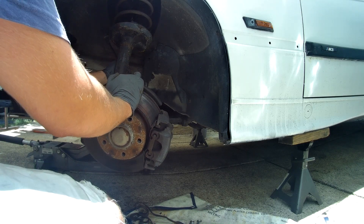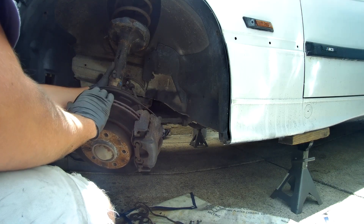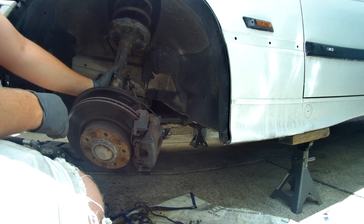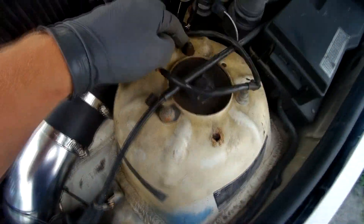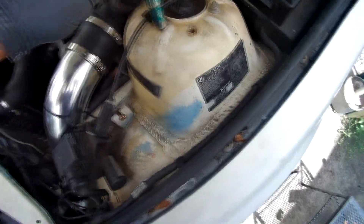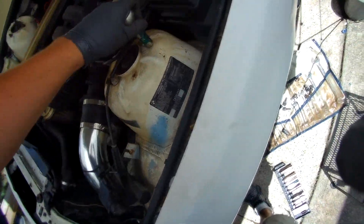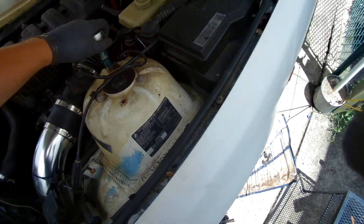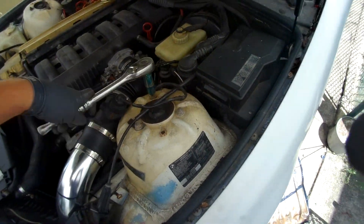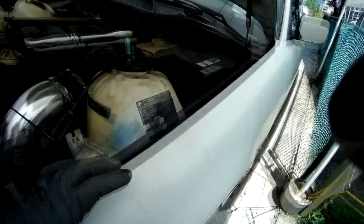Try not to put too much pressure on your brake line over here because it can rip. So let's leave this like this for now. You've got to open the hood and take the three nuts off the top of the shock tower. On the strut tower we have one, two, three bolts. Shouldn't be too hard — take your 13mm and your ratchet, give it a tug, comes right loose. You do that for all three. As you loosen these, what's going to happen is the shock is going to come down, because that's all that's holding it in right now. So as it comes down, you're going to want to grab it from underneath as you're loosening this.